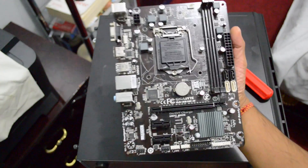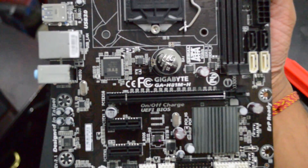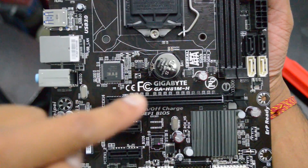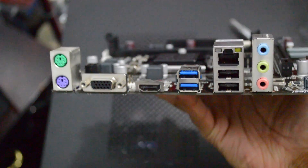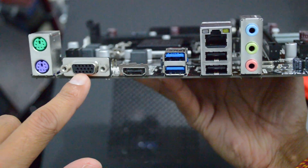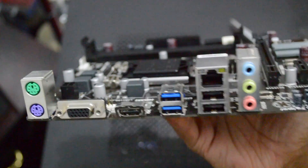I'm not going to use any dedicated graphics card — I'm just going to use the Intel HD 4600 integrated graphics that come with the CPU. The motherboard I have here is the Gigabyte H81M-H, a great motherboard for Hackintosh. If you're planning to build a Hackintosh, you can go with this motherboard. If you get the H81M-HD2, that's a bit better because this board doesn't come with DVI — only VGA and HDMI. The problem with HDMI on a Hackintosh is you can't get sound out of it.